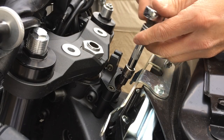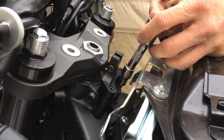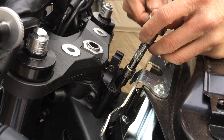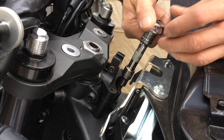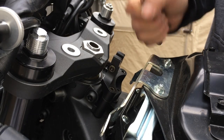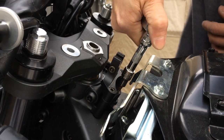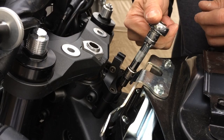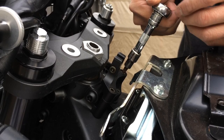So that's all the way down. This is a small head, it's only a 5mm Allen, so torque-wise it doesn't need much. It's where I hold my handle — I'm not holding the handle all the way back here, that's too much torque. I'm holding it right here. So once it starts to feel tight, I know I'm pretty good. Right about there, I'm good. I'm gonna check these two just in case.